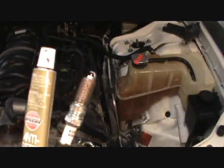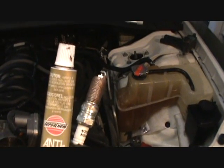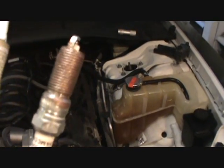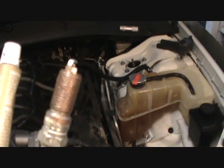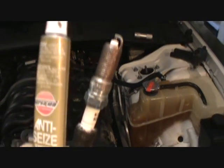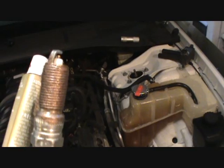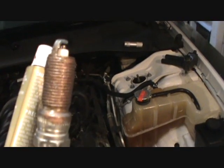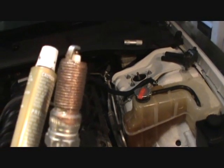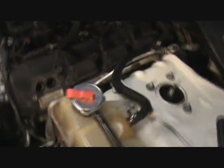Anyway, okie dokie. So, the anti-seize that comes in this tube for like $3 is way superior to the stuff that they give you as a sample behind the counter when you buy plugs. So get the stuff in the tube, which is way better than the free stuff. Now they show putting it on the threads with a brush. I stuck it on with my finger, trying to keep it off the electrodes and such. They show putting on copious amounts, so I figured shitloads would be enough.